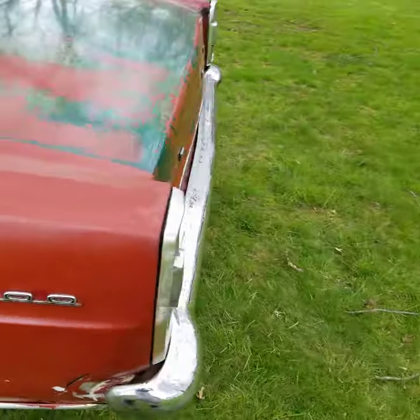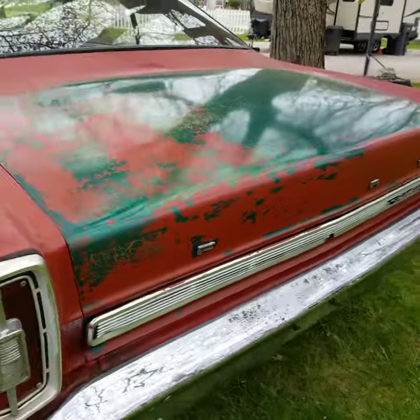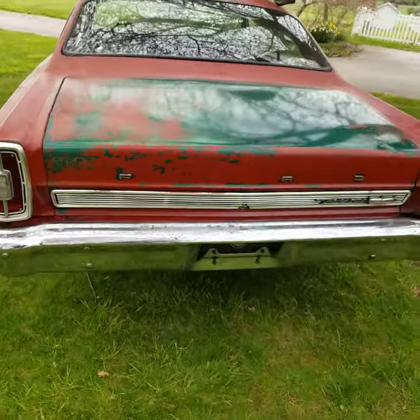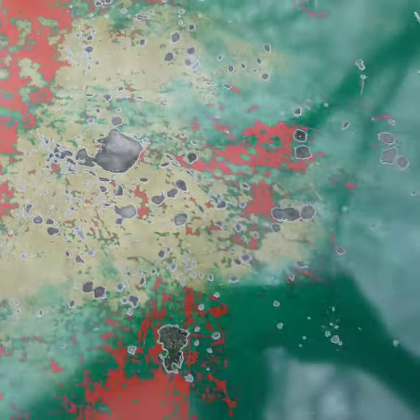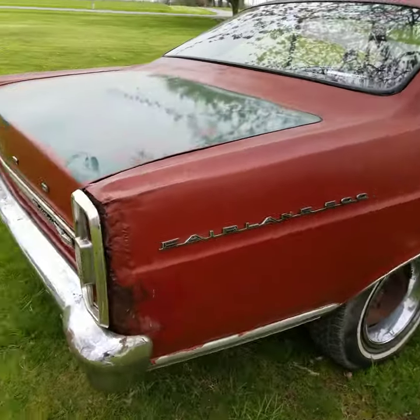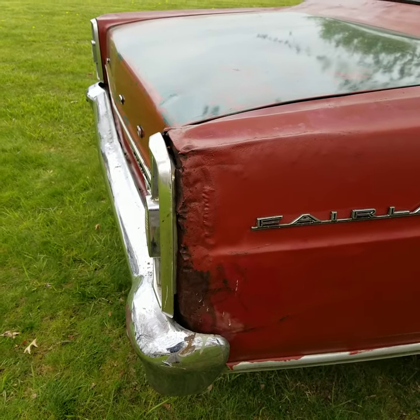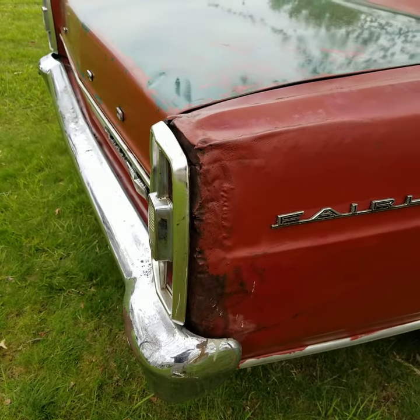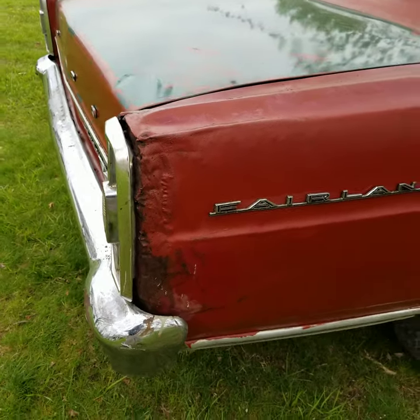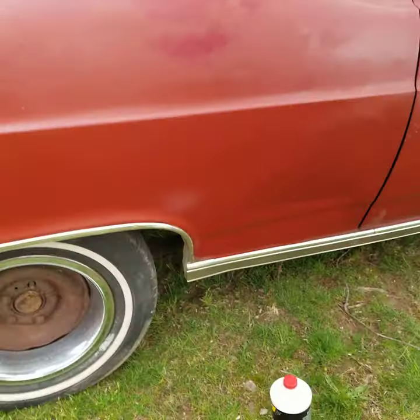Going to the trunk. There's some mud right there, but this quarter needs a lot of work anyway. If you're planning on replacing it, a lot of people would just rat-rod it. This quarter panel has a little bit of rust — not near as bad as the other side. It looks like it got whacked when somebody started to do the metal repair. I think a good body man with some shrinking hammers, dollies, and some heat could probably get that pretty close, skim it, and block it. It's going to take some hours, though. There's also a crease in the quarter panel right here.